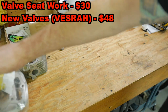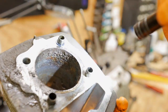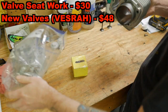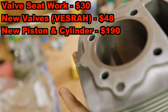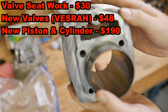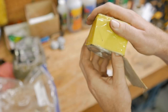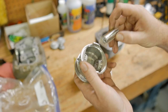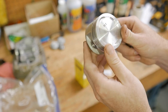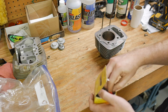We also got a two-over bore from standard cylinder. Look at that pretty thing — I found one online for relatively cheap. It looks like it was already vapor honed and the cross-hatching looks mint. It was bored over and this looks really good; I'm totally happy with that. It even came with a piston — not sure what brand it is, 0.75 which is the over bore, probably aftermarket. Came with pin clips, a new pin boss, and some rings. I'll totally run this — I'm not going to get a Honda piston or anything like that, I'll run it the way that it is.